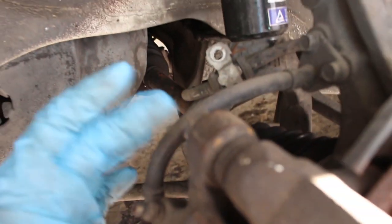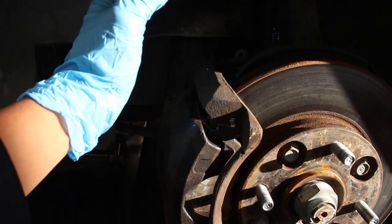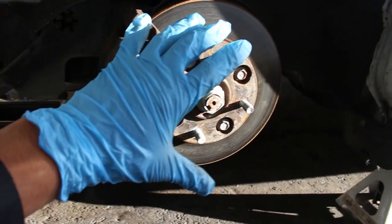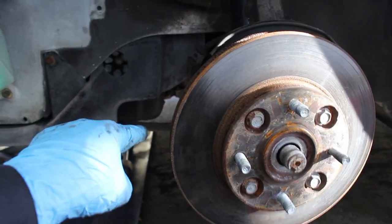And instead of doing it from the guide pins over here, I'm just gonna go ahead and remove it from the caliper bolts. So it should be two 17 millimeter bolts that hold the brake caliper bracket to the knuckle. I'm gonna go ahead and remove those two, get the brakes out of the way, and get the axle nut off. We got the brake caliper out of the way,